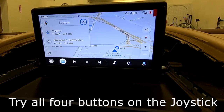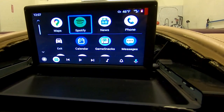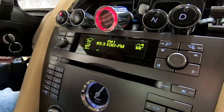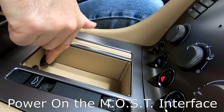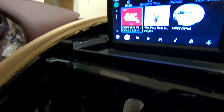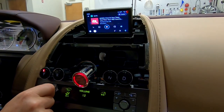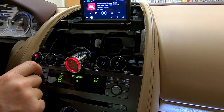I can use the home button to take me back to the main Android Auto screen — that's awesome. Let's try some music. I'm going to select Spotify. Now if we listen, this is still the radio playing, which threw me for a loop the first time. We need to switch the MOST switch — that toggle turns on the fiber optic interface and tells the multimedia module to take over the audio feed. Once that's on, we're not listening to radio anymore. The volume control on the head unit is working.